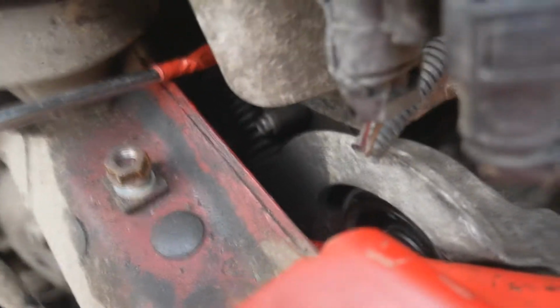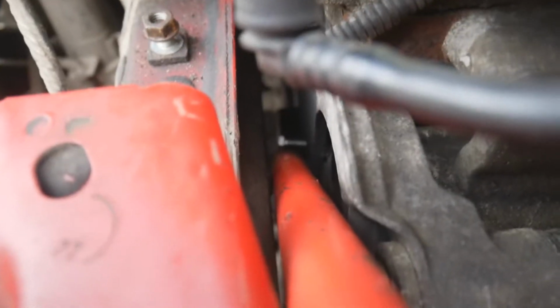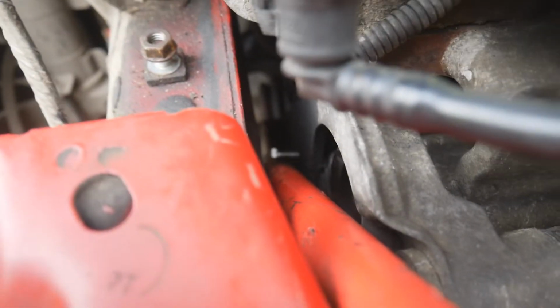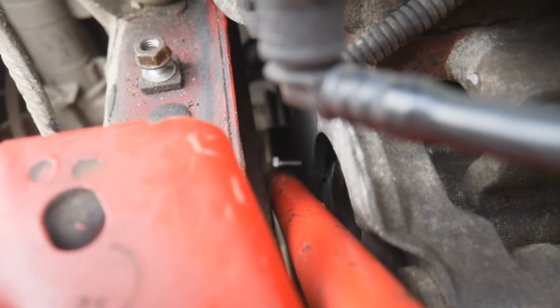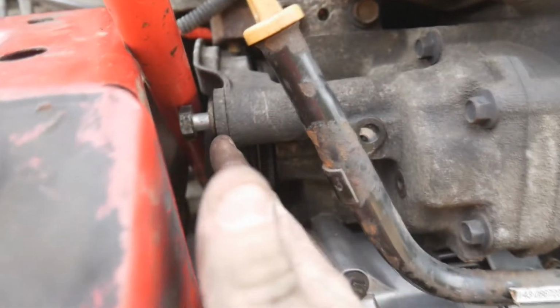So as you can see in here, there is a silver bolt there, and there's just a little bolt that I had spare. And on the side of the tensioner wheel there's 3 holes. So I basically bolted that little bolt into there, cut it down and put it in. And then I put this 16mm bolt on the top of the tensioner back in, but left it out a touch. And then I used the jack handle to lever it forwards.